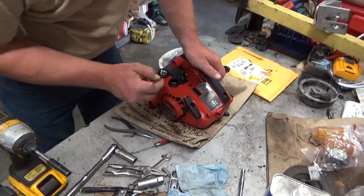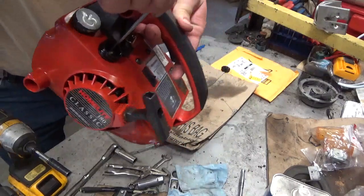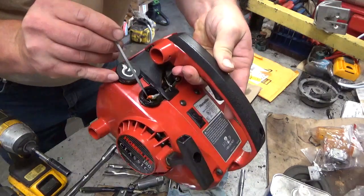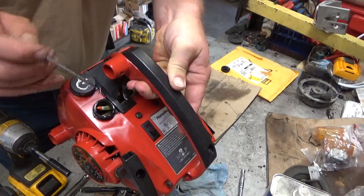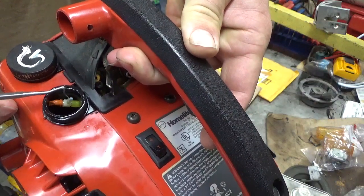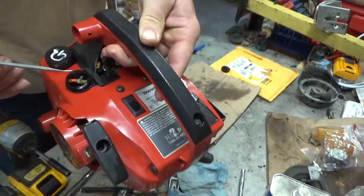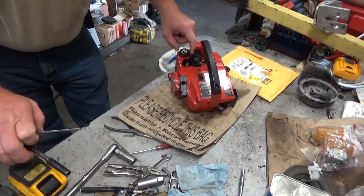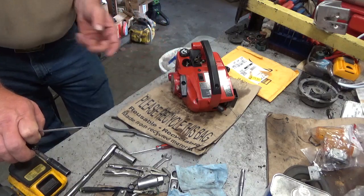These late models use a T-shaped piece, and I'll be damned if I know. There, I think you guys can see that. I don't want to pull it loose. You can see how the duckbill is on one end, and the other end has nothing on it. Well, you see how that port has that kind of blue insert. Most of them are orange. This one's blue, doesn't matter. There's a very small hole there. That fitting takes the place of the old brass sintered tube. And that hole is there to allow pressure to bleed back into the engine while the saw is off.